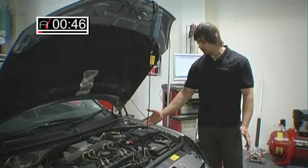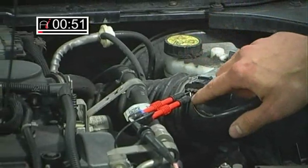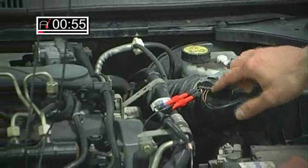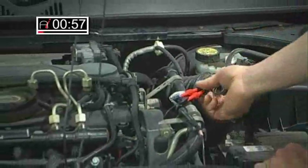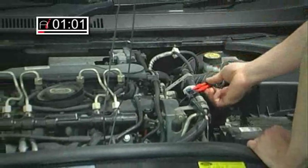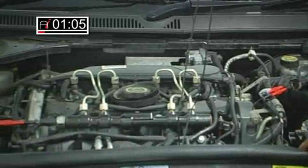So how do we test it? Pretty simple. What we've got here is four wires — usually you've got a 12 volt supply, two earths, and a signal. The output signal is usually the one closest to the engine but it's quite easy to find. I'm going to be checking the fueling as well on this car.